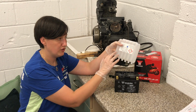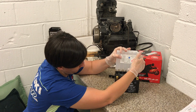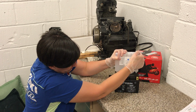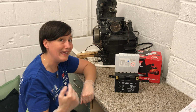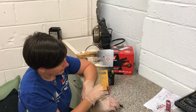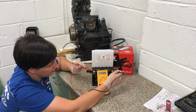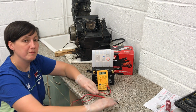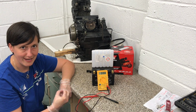So we've got the 6 individual cells of the sulfuric acid, and what we're going to do is line them up with these holes here and just push it down gently but firmly. Now you can hear it and you can see the bubbles flipping right up to the top here. The acid is in the battery now, so to check the voltage again, there, it jumped up to 12.6 volts. So at the moment the battery is about 70% charged just with the solution going in.